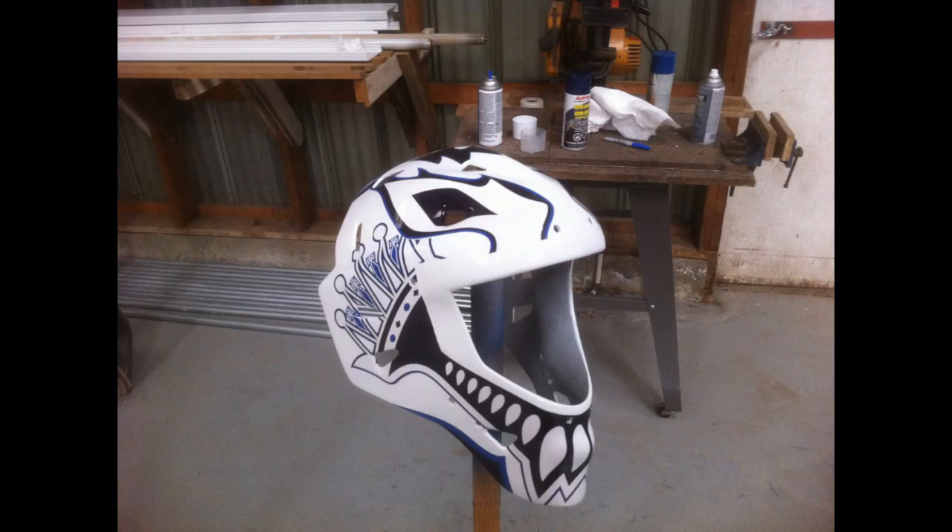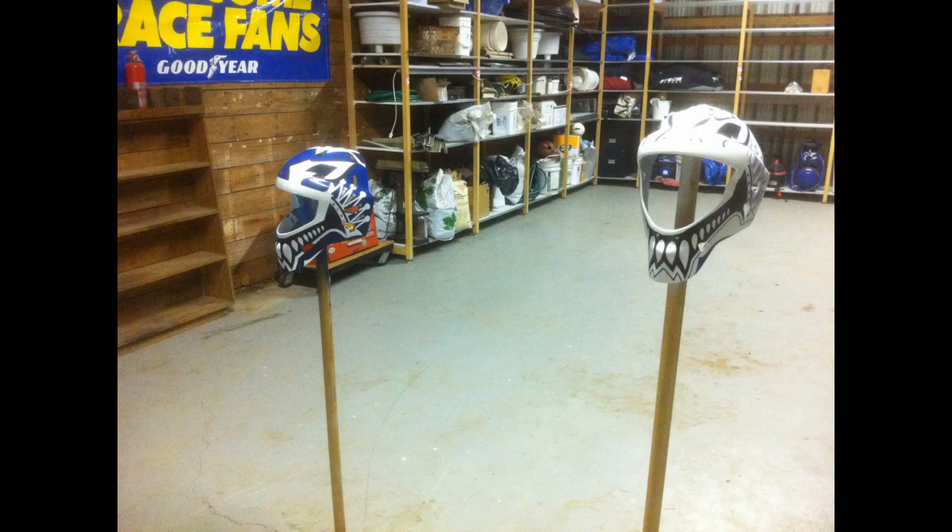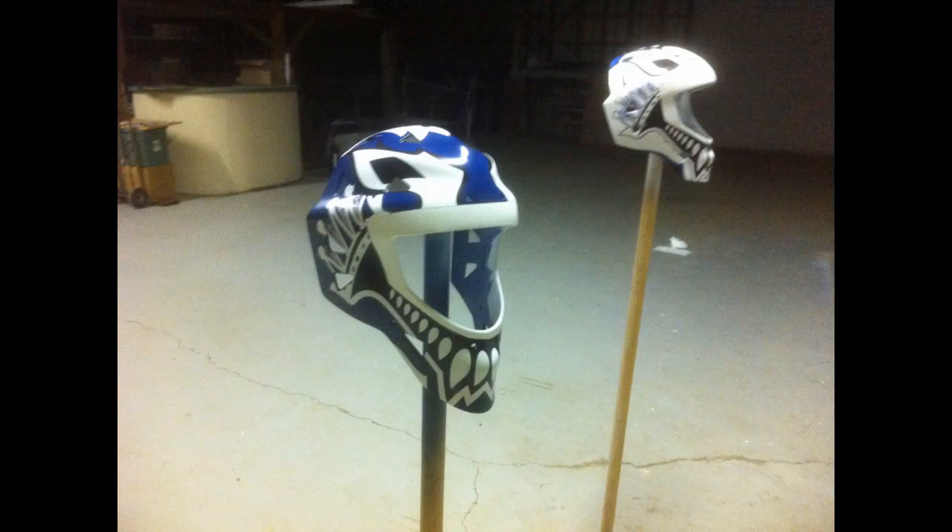After that I had fun and did some clearing. I got a can of clear from the paint shop and used about a whole spray can on one helmet. We did three helmets, so that was three cans of clear. Because you're using vinyl, you want to make sure you get the clear over the vinyl really well, covering that little bump where the vinyl meets the paint. You want to do a good two or three coats of clear coat on there.